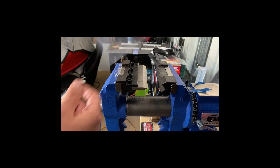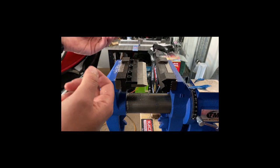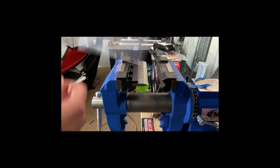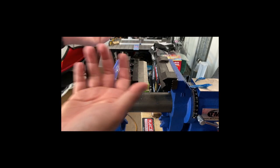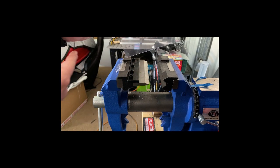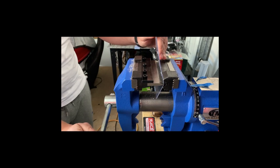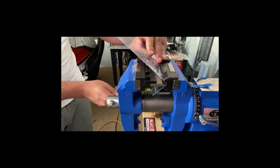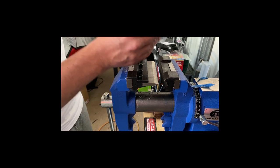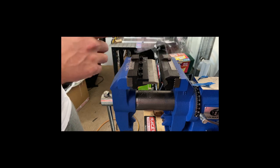To illustrate how this polycarbonate bends like sheet metal, I've got a vice bender here, which is used for bending up to about 3 mil aluminium or 1.8 mild steel. You could also just clamp it at both sides to a workbench and bend it down, or do it gently with a soft-face hammer. I've got a pan brake bender that does up to 300 mil gauge as well, but it's still useful to work with what you've got. For example, to bend along one side you just line it up and bend to whatever angle you need — keep in mind it'll flex back a bit. We'll go for a 90-degree bend here.